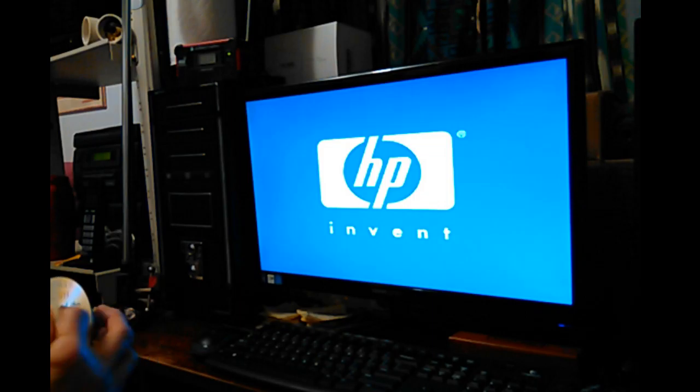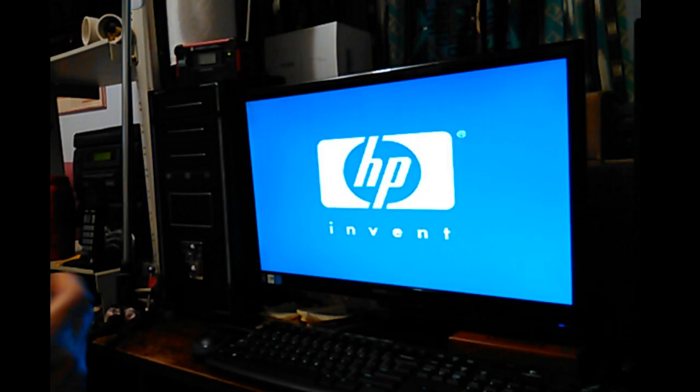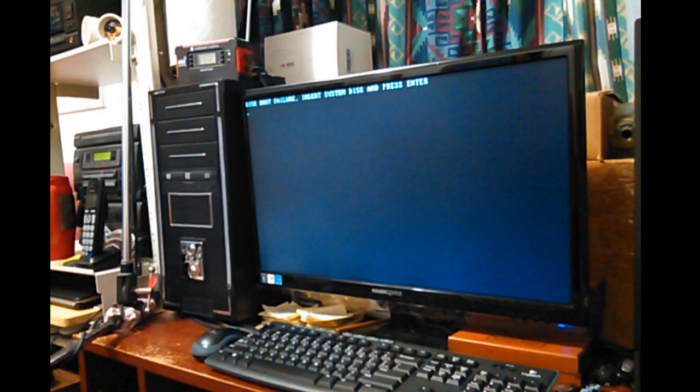Oh, well, I hear it. Boot failure. Insert system disk and press enter. Yeah, it can't boot to that floppy. Okay. So I'd have to write one on this to use my Plop. Now, either that floppy doesn't work, or it's just not formatted right. And I've run into that. In the last couple of years, I've got out some old machines and fiddled with them. I had decided the floppy didn't work, and it turned out, no, it wasn't the floppy. It was just written in one that wasn't compatible.